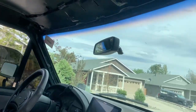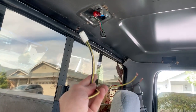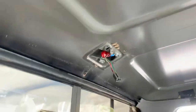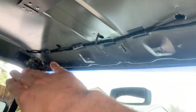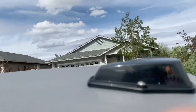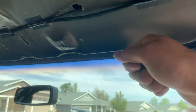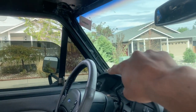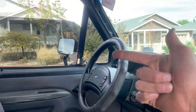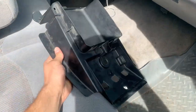Here we are at the truck. One of the first things I'm going to do is deal with the old plug for the dome light — I have a new pigtail so I'll have to build a new setup for that, just three wires. I built this wiring harness and taped it to the roof so it's out of the way. It also runs up to the cap lights and goes to the mirrors on the sun visors so the lights on the sun visors will work. It drops down and runs into the back of the headlight switch — you need constant 12 volt and the parking wires for the marker lights.